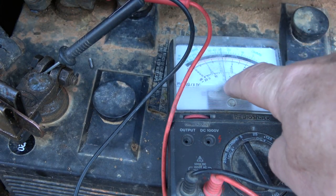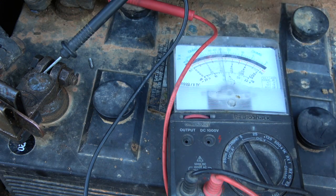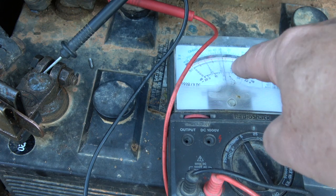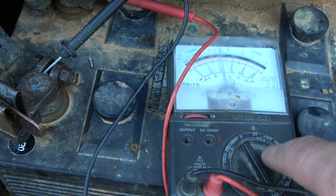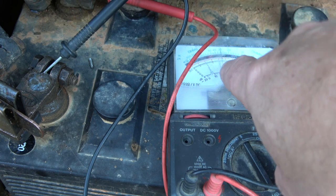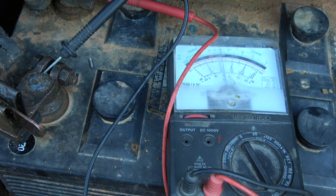What we're wanting to look at here is this gauge. Notice this is not a digital gauge, so you don't see numbers. We're going in 5, 10, 15, 20, and 25 range because I have it set to 25. Coming up here, that shows about 11 volts, so already I know there's something wrong with this battery.